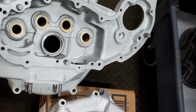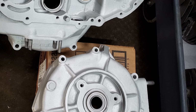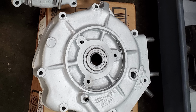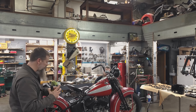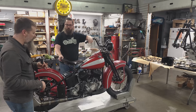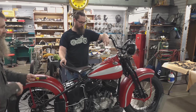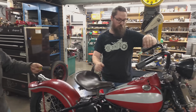When I built the engine, the motor was locked, but everything inside was like brand new. So the cams, the flywheels, the connecting rods, pistons had some wear. So we ended up reboring it out to 80 cubic inches, putting some bigger pistons in. Had our guy Ken, and you guys have heard me talk about Ken over and over, rebalance the crank. 4-speed transmission with close ratio gears. This thing ought to honk. We're ready to fire it right now.